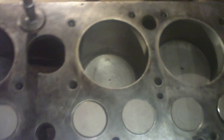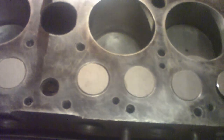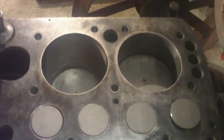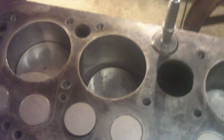Here's a neat thing — on this valve right here, on the head of the valve it actually says Fordson on it, which is kind of neat. We pulled two of those valves out of this block, so there were two factory original Fordson valves still in here. Like I said, we reamed the guides with a 313 reamer — we could have maybe even used a 314 and it probably would have given nice clearance too. I have my two rebabbited and remachined rods in cylinders three and four, shimmed all proper, and the motor turns over nice and easy, which is good.